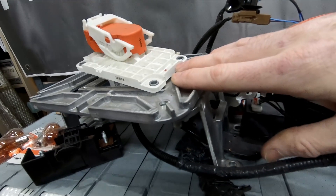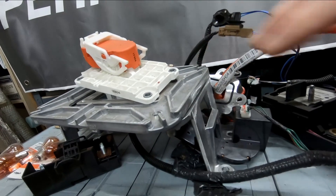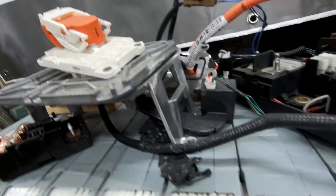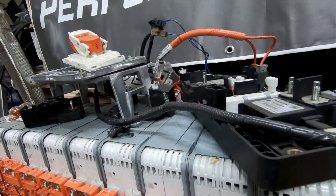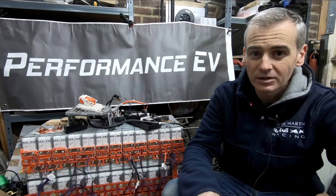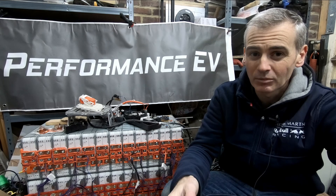In terms of the isolation switch, I'm going to put that in a similar way to how it was done in the Leaf battery pack — partway through the pack, splitting the pack in two, so the two live ends aren't connected and therefore there's no power going through them. The most logical place to put it is in place of this bus bar, with a couple of wires going from each of those terminals to the isolation switch. I'll probably cut down the mount a bit so it doesn't sit as high — it needed to clear a lot in the Leaf pack but it doesn't in our orientation. While we're waiting for this stuff to get built out and delivered, I can switch my attention back to the motor and trying to get that more secure in the car.